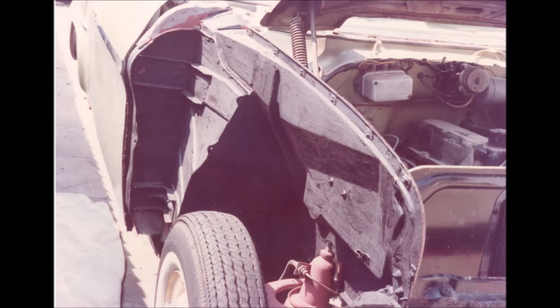Unfortunately I can't say the same for the top hinge pillar — you can see a new bracket being welded. If you look underneath the bottom hinge pillar you can see nothing, and the reason you couldn't see anything is because there wasn't anything chassis-wise past the front hinge pillar. You can see three little rust holes there, and that's where the chassis ended.